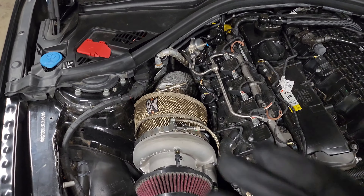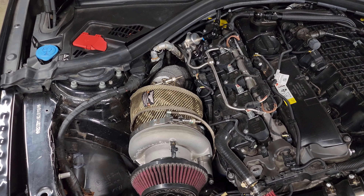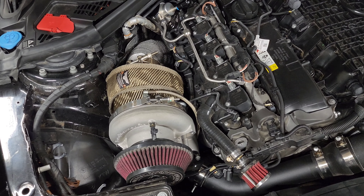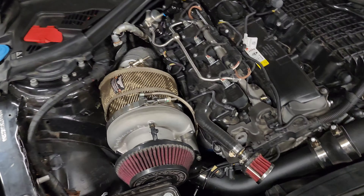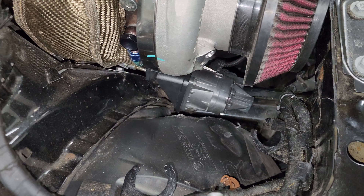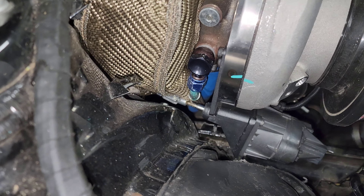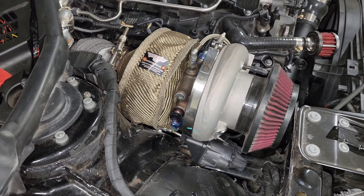The big thing I'm going to be upgrading is my turbo blanket. I got it from PTP and it's designed for an EFR turbo, so it fits pretty well, but there are a lot of ways it can be improved, especially in the way it's used in our cars. We don't use the regular wastegate that comes with an EFR turbo — we remove that and install an adapter to reuse the stock electronic wastegate for the B58 engine, which really decreases how much room you have. My wastegate is sandwiched between the turbo and the side of the engine bay, so it's pretty much rubbing right now and it's really hard to get the turbo blanket to sit all the way down because of how tight everything is.